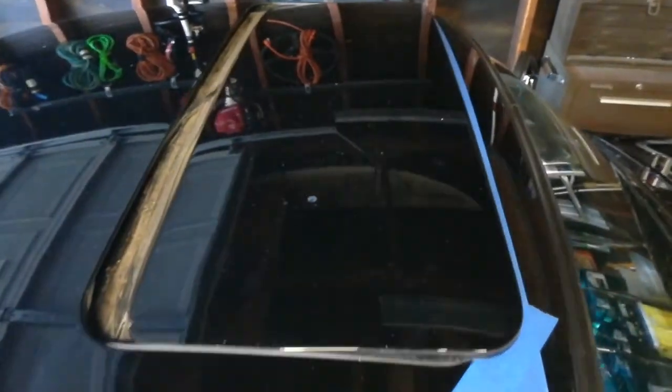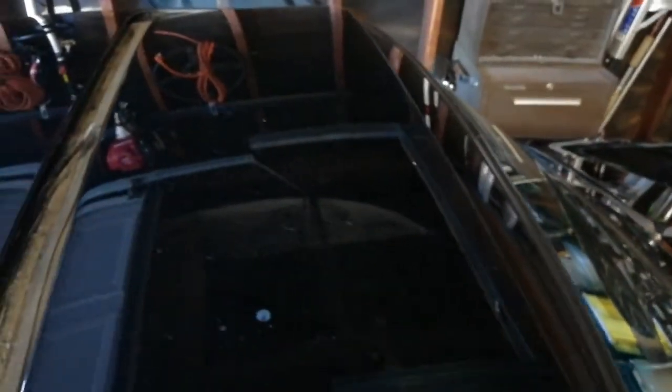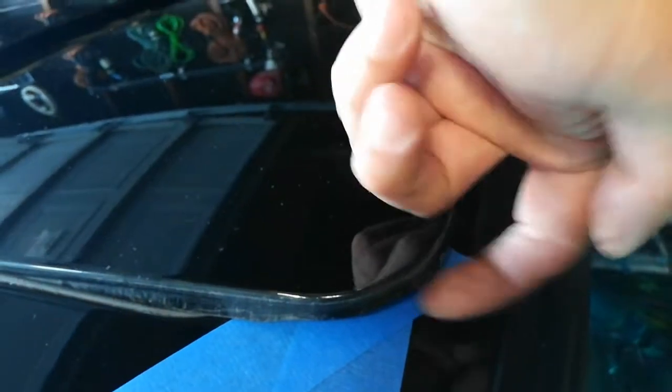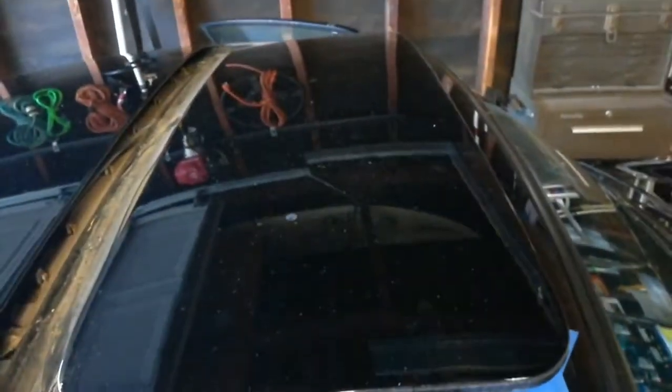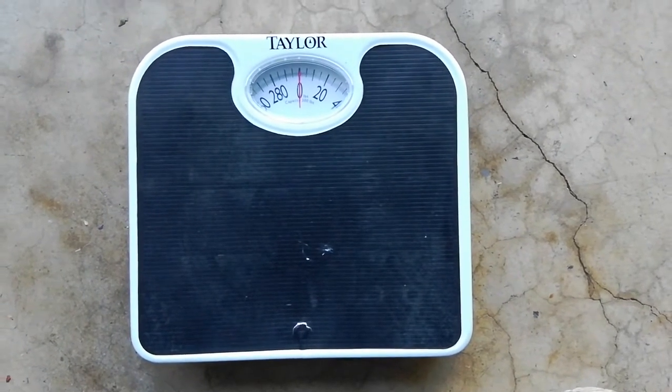After you've released the hardware from all four corners, support the front of the panel from the inside, push up, and you can see it coming off — now it's completely released. That's the reason we taped the front of the opening, so that if the panel rests on top of the paint you're not accidentally scratching it with this sharp metal edge. I'm going to put the camera down and lift this off because it's surprisingly heavy.